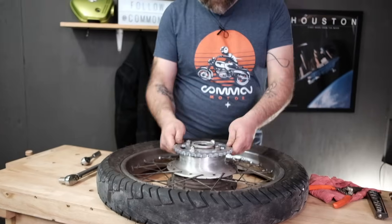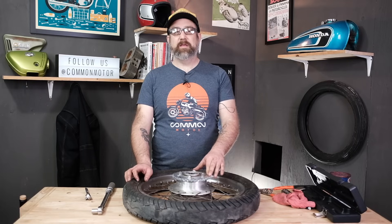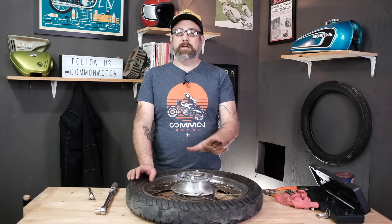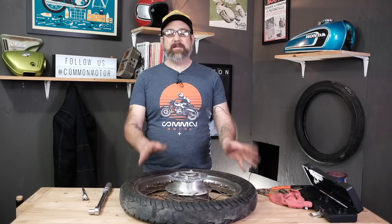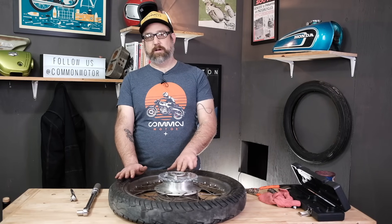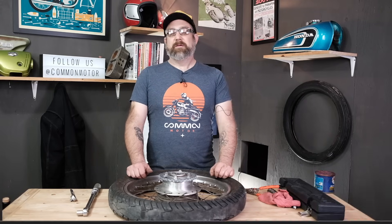All right, that's it — rear sprocket installed, ready to go back on the bike. I hope this video gives you a little bit more information about what it means to swap sprockets, whether it's on a 350, 360, or 450. The four-cylinder bikes like the 550 and 750 use a very similar sprocket layout on the rear hub assembly — they're technically different, but if you understand this one, you should be able to translate it over. Make sure you look at your torque values for your specific bike, and use thread locker on your bolts as needed. The front sprockets on all the bikes are done identically, so it doesn't really matter what model you have. This is Brendan with Common Motor — that's common-motor.com. Make sure you like us on Facebook and Instagram, subscribe to our newsletter via our website, and subscribe to this YouTube channel.